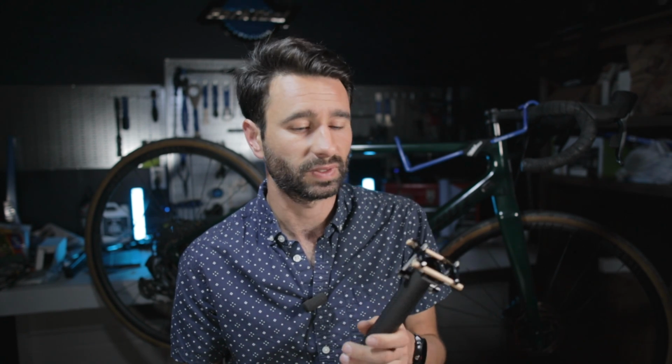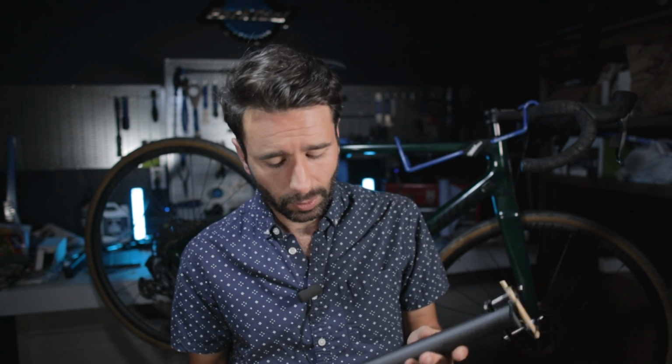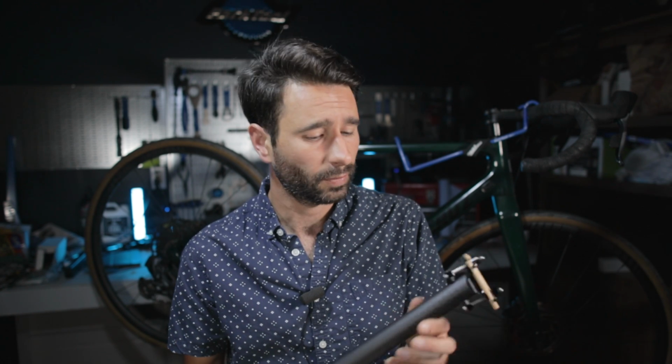And so when I was offered to take a look at this for review purposes, I said, you know, let's check it out. So I'm gonna be installing this today on my Santa Cruz Stigmata I've got here behind me. Now, this is my gravel bike that I haven't actually really shown on the channel at all, but I figured this would be a great bike for the seat post. Now, the seat post comes in at about 148 grams, at least according to my scale. This is in the 350 millimeter length in the 27.2 diameter, which is, if you compare it to other 27.2 seat posts, really competitive. It is up there for one of the lighter seat posts.